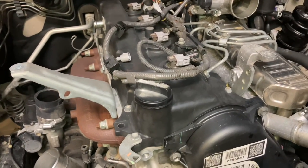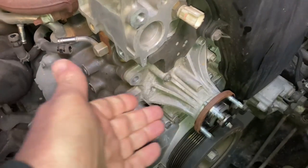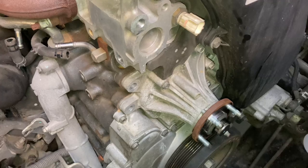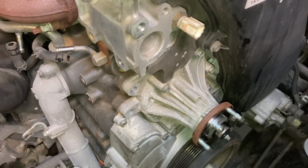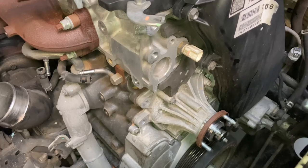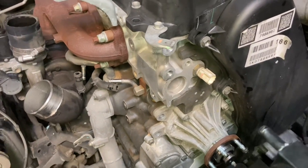And if you do that, you do the timing belt, the idler, the tensioner, all the stuff in behind here, all the bearings — you've just got a super reliable vehicle for 150,000 ks. Probably even longer, but 150k is a long time, so you spend a little bit of money every 150k to keep that Toyota feeling. Hey, even Toyota don't tell you to do these things. They put a one-piece pump on there that's very difficult, creating a lot of work to change. I've really got no idea why they do it.